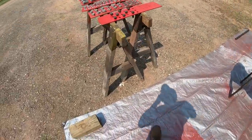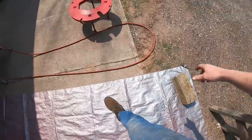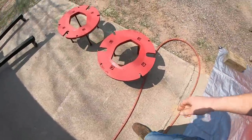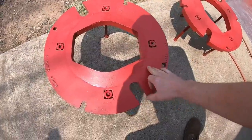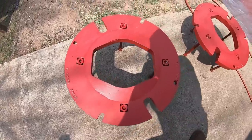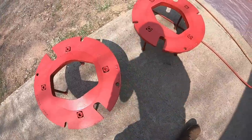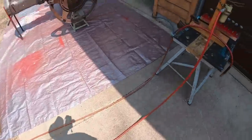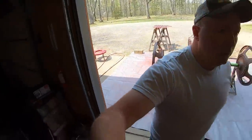And if we have any surplus primer and paint, I've got a lot of wheel clamp hardware, and I can even retouch the wheel weights. These were done with the professional grade paint we put on the Super M the last time, so it's a good surface that's still intact. I just scuffed it, give it a little bit of tooth, and we can just hit that with the color. So everything's set out here. We'll just see how it goes.